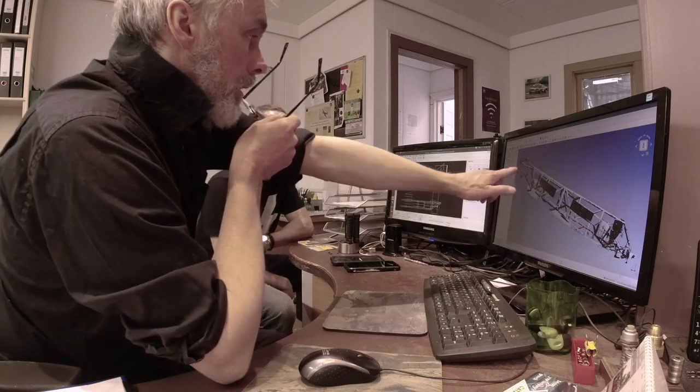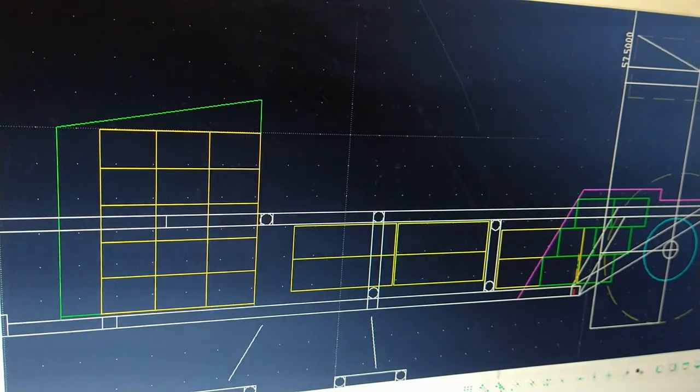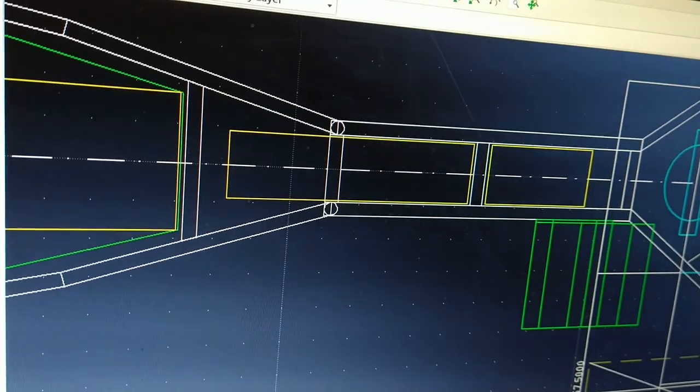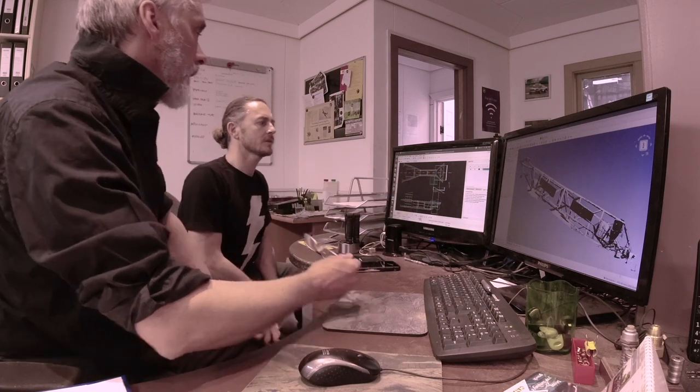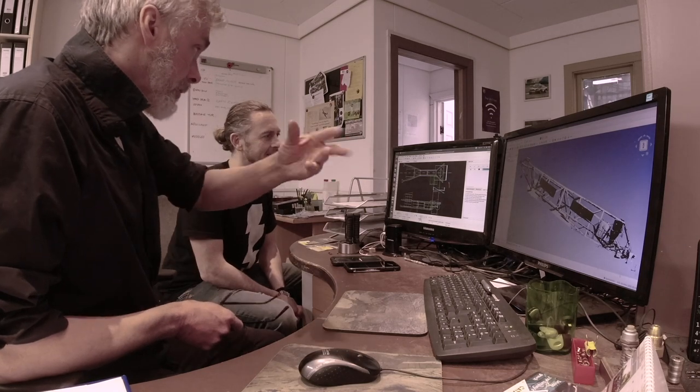So what have you got for us? We've had a look at your chassis. That's the front of your chassis, that's the back of it — your diff normally goes under that bit there. These are some ideas of where we can put battery packs. The yellow ones are potentially battery pack spaces we can use. This bit here is where your fuel tank used to go — that's where all those green ones are, a complicated space to use but a possibility. We've had a look at down the spine of the chassis — it was just support bars and bracing bars all over it, which makes it really impossible to get anything useful in there. We've still got to get some services down there as well, things like handbrake cables and wiring looms, so the spine is not looking like a good option.